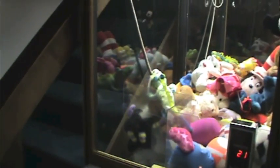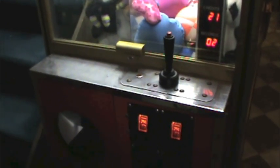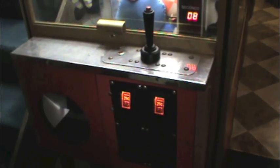I had to make a bunch of repairs to it. Unfortunately, I didn't get a chance to catalog them on video, but I'll describe what I did. A lot of the same repairs I did to this machine. Things like micro switches were faulty. It had a wiring harness issue. It had the claw coil shorted out and blew up about 1/8 of the control board, so I had to fix that. Actually, I ended up replacing the board. But anyway, you'll see these things when I'm ready to make that video. But I'm going to close this up and we'll try to win some stuff.